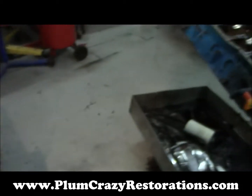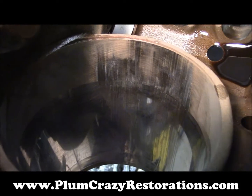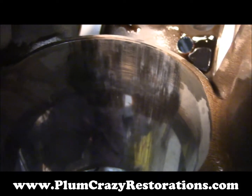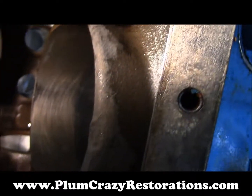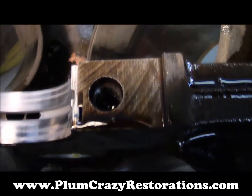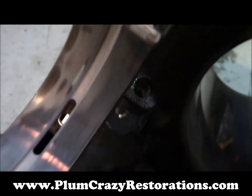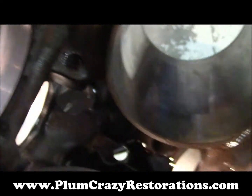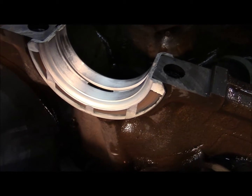If we go over to the motor and have a look, you can see it's actually really worn on the cylinders themselves. So the motor is going to have to get checked out at the machine shop and probably get bored out. These are the main bearings in the block as well, and they show signs of wear — the front bearing shows excessive wear on the sides as well.